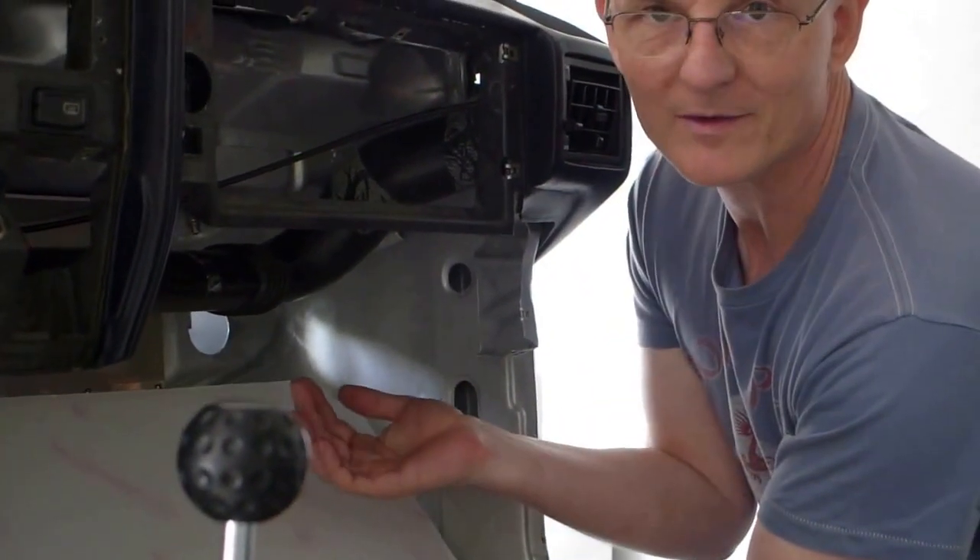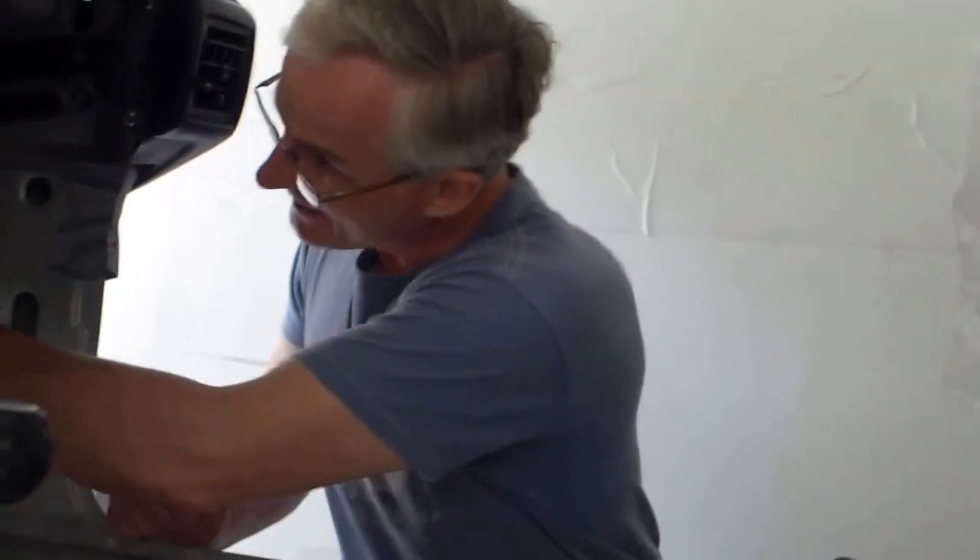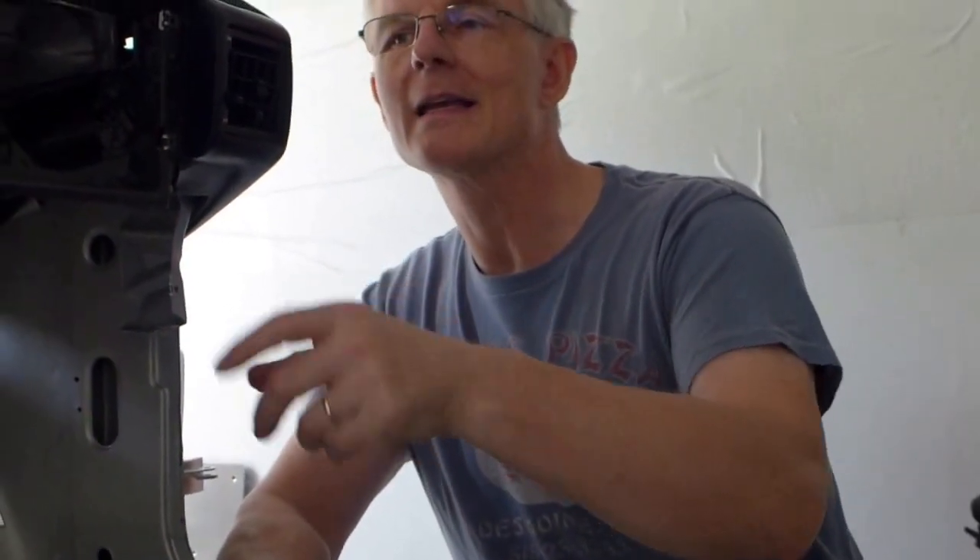I'll be able to flip it down, have the amp there, and all my electrical connections. I'm mounting a lithium-ion battery in the trunk and running 1-aught super flexible welding cables along the side under the carpet and then up into the distribution panels. Lightweight 5-pound racing battery in the back, very heavy gauge thousand-strand wire running to the front, then distribution there. I'm going to have a wireless secure fob in my pocket that will disconnect the battery — I'll connect the battery wirelessly, flick a hidden switch in the ashtray to enable the ignition, and then have a start button, so I won't use a key in the steering column.